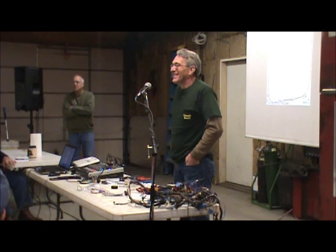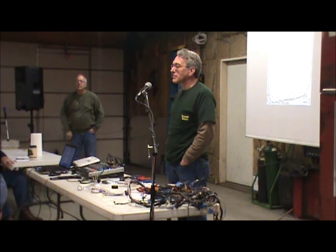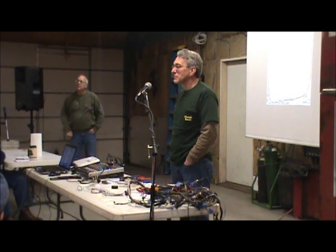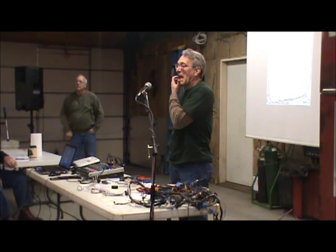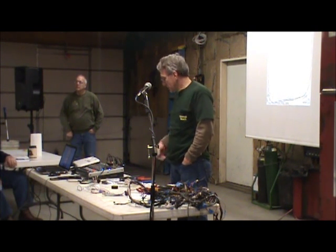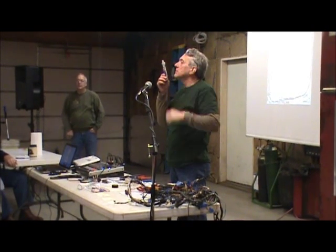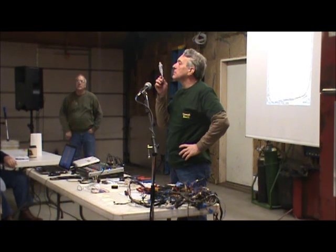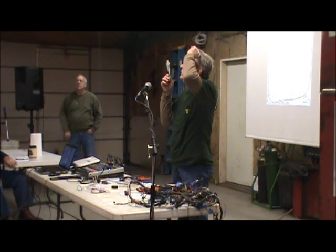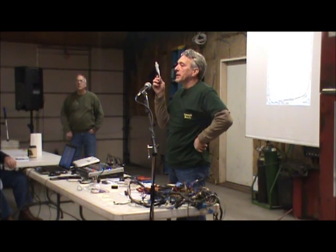Just a theoretical thing, going back to the dielectric piece. I've always been a little bit confused about that because the grease itself is not a conductor. Correct, it's not a conductor. But I've used it on sockets for screw-in bulbs and things like that. So it would seem that it would interfere with the connection, but it never seems to. Really, what's happening is your connection is still displacing it. It just keeps moisture out and keeps it from corroding. That's all it really does. Yeah, but as you're putting it together, it's scraping it apart.